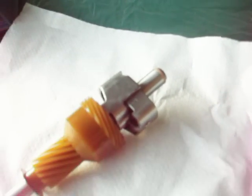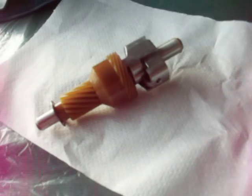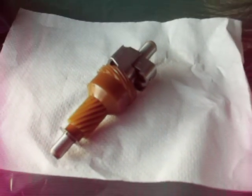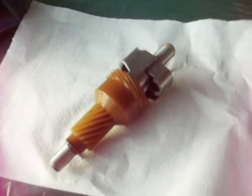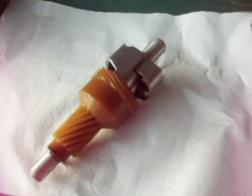You do this in small increments — if you take off too much weight, it will never upshift even with your foot to the floor, so you want to do this in small increments. Hopefully I'll get it right on the first time, and even if I bring the automatic upshift up to like 4200–4300 RPM, that'll be more than enough. It'll be perfectly fine for turning onto a highway — I won't have to grab a lower gear because the car just won't stay in a low gear long enough to stay in its torque range.